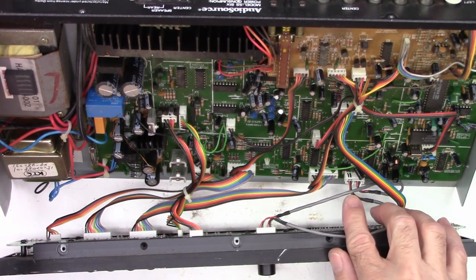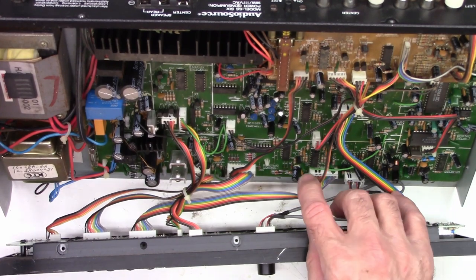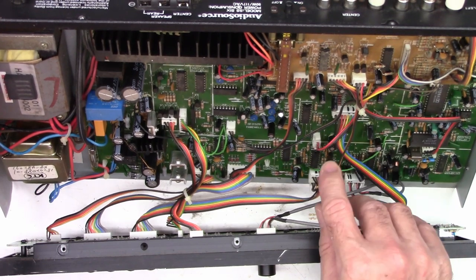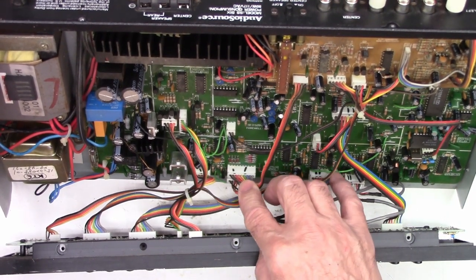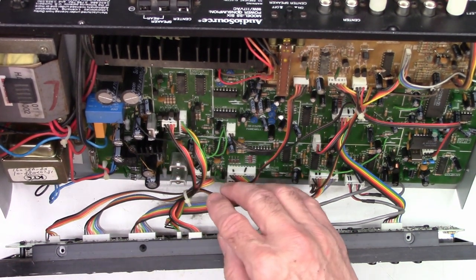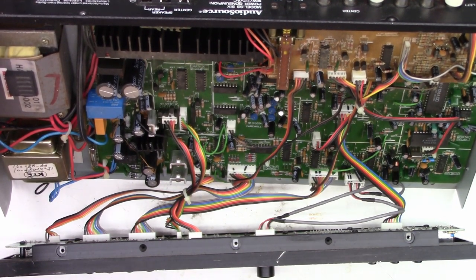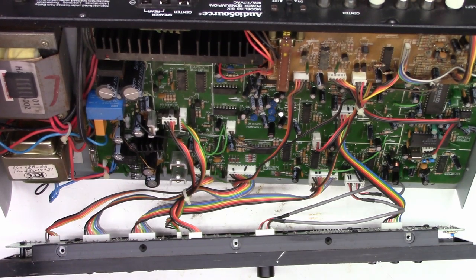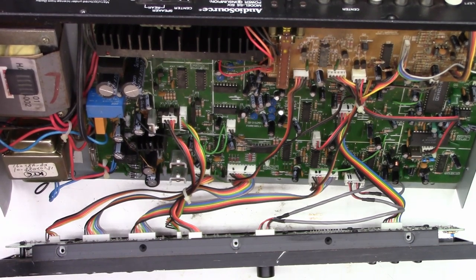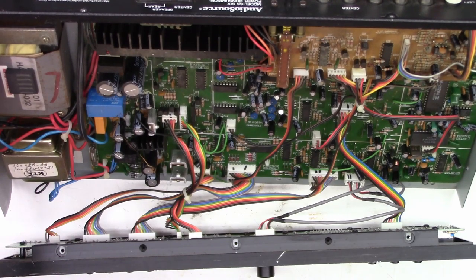I made marks on both the plug side and the connector side, and each one is unique — some are spaced far apart, some close together, some really far apart. I put marks on all these connectors so I can get them plugged back in the right connectors. That's just a tip: if you take something apart, sometimes you'll have multiple plugs with the same number of wires and they could interchange, so put some unique marks on the connectors so you don't get them plugged into the wrong ones.